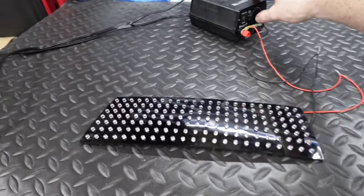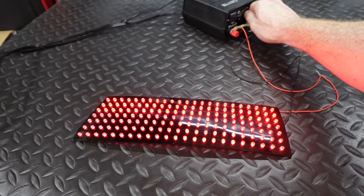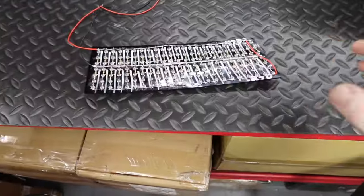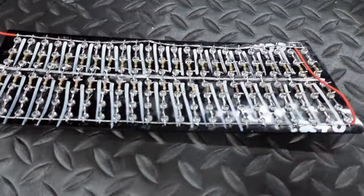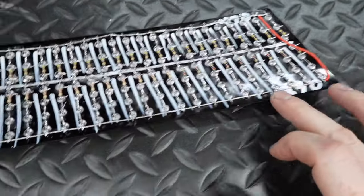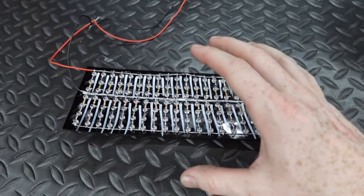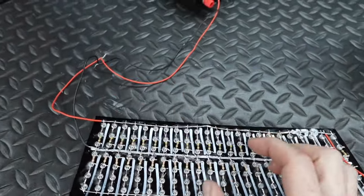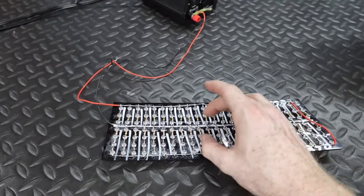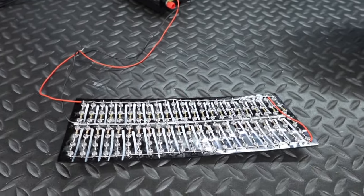The bottom board is completely built out. Here's the parking light at low brightness, and when we pump up the voltage to 12V, that's our brake light — nice and bright. Flipping it over, you can see how everything is wired: power running on top, jumping down, power across the bottom, and ground right down the middle. Once installed inside the taillight housing, the parking light and brake light control module will sit inside — possibly mounted right on the board itself as one unit for easy installation.